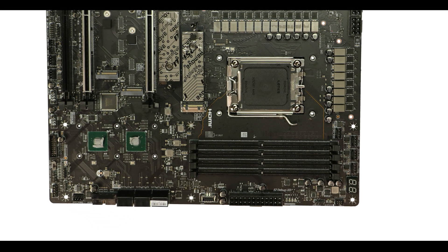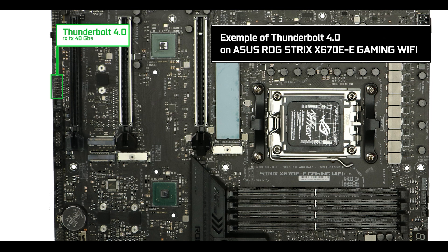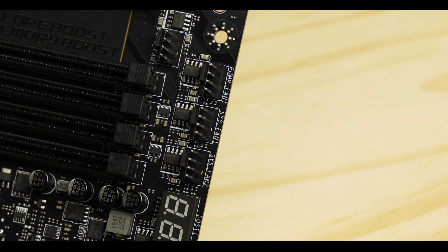Front panel connector-wise, we have our usual USB 2.0s, USB 3.1 plugs, and a 10Gbps Type-C, but most noticeably no Thunderbolt 4 connector — a big omission at that price range. Cooling-wise, we have seven PWM fan connectors, one of which can handle an all-in-one water cooler. Despite having an additional temperature sensor, there is no flow sensor or dedicated D5 pump connector, which is disappointing given this motherboard's potential as a custom water cooling foundation — especially with dual GPU support, a strong VRM, and an EKWB monoblock available.